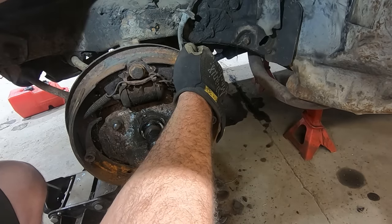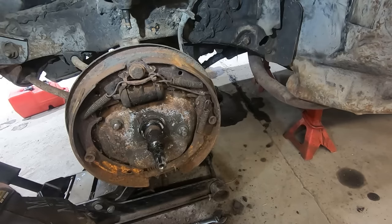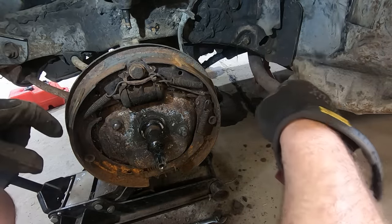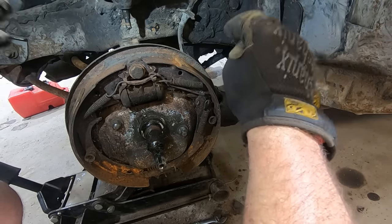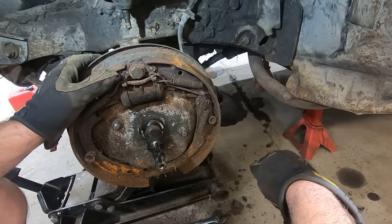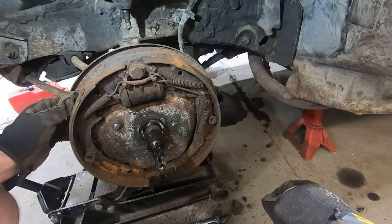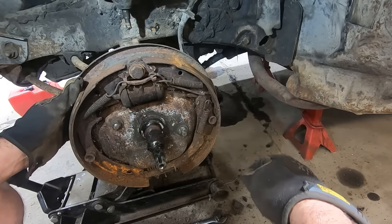We could take the bump stop out of there, but we might need that if we're gonna go jump some approaches. So how can we do this? What kind of sketchy things can we dream up? If we had some steel tie downs or some type of anchors in the floor, we could anchor the frame down and jack up on the control arm and get it closer to it. But we don't. We could put a bunch of ballast on the frame, but that seems really dumb and hard to do. So let's get a chain and put a chain underneath the jack and over the frame so it can't go anywhere. Seems like a pretty harebrained idea. Just might work. Brilliant!